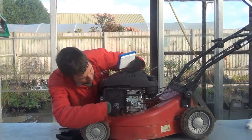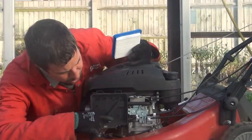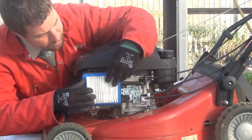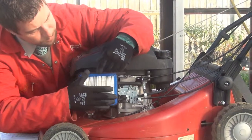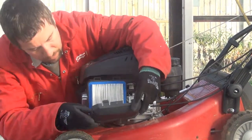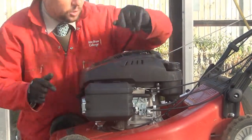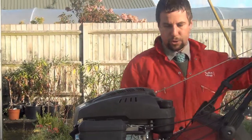We also just have a look around the inside to make sure that's not too dirty — and that's fine on that machine. So we then put it all back together again, making sure the filter fins are out, put the filter casing in, put the cover back on and snap that back into place. So that's the filter checked.